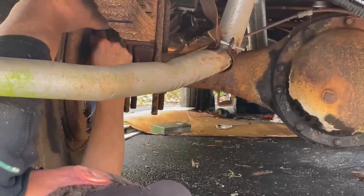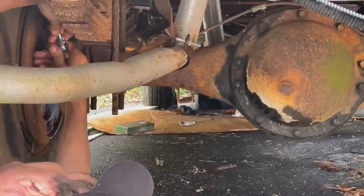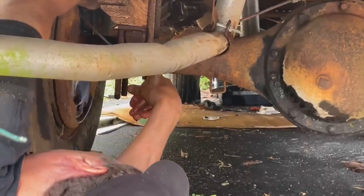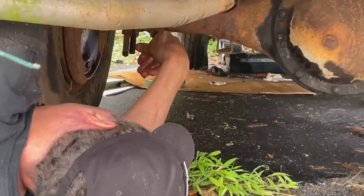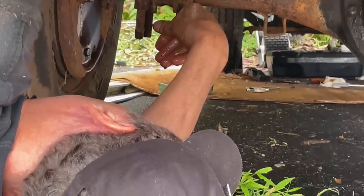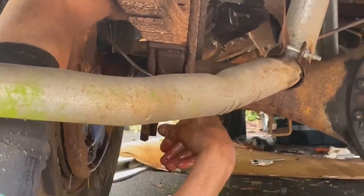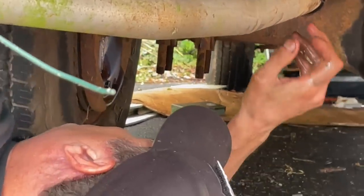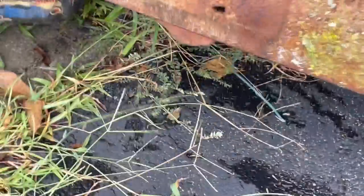Okay, let up. There is a lot of air in this one. Let's try this one more time. I'll go real slow this time. 1, 2, pressure that time. 3, much better. 4, I'm getting the workout. And 5, holding, all the way to the floor. I heard that. That was real good. There's still a ton of air in here, but I can actually hear the brakes working now. Good. In this wheel, we can let up.